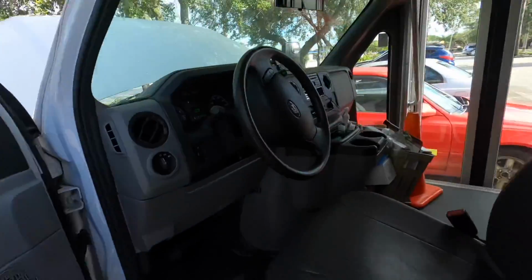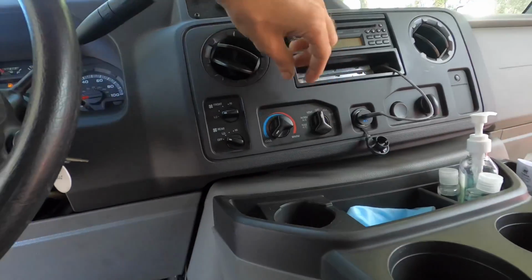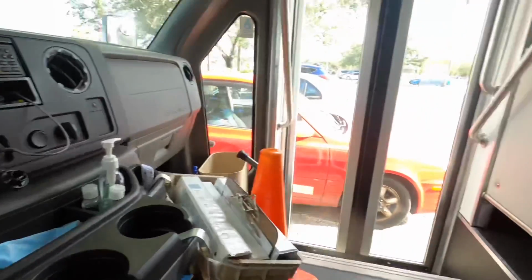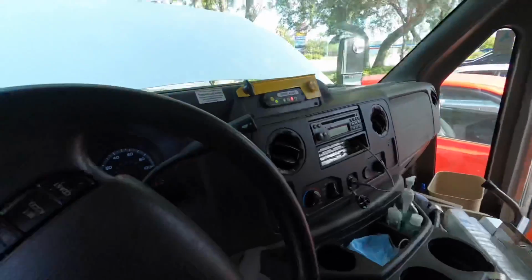It is changing with the AC load, but I'm not so certain that it is in fact one of the compressors. This has dual air, one for up front, and there's a secondary system back there up on the ceiling, so it's gonna have two compressors that run this cooling system.